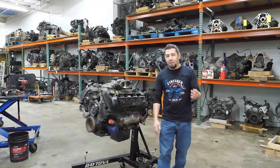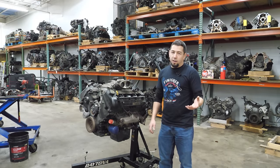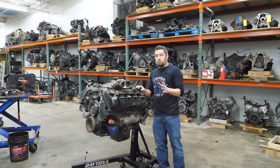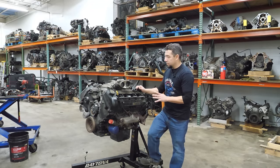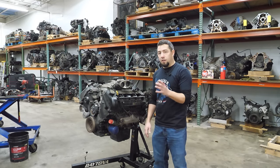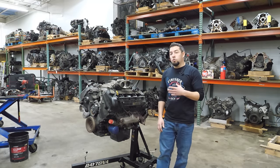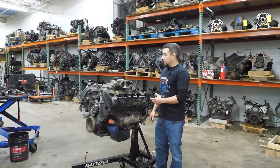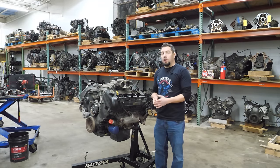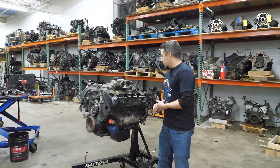I'm going to mention his YouTube gaming channel - he didn't ask me to, but I'll leave a link in the video description. This engine has 155,000 miles on it. It suffered some thermostat issues a few times, so it may have overheated more than once. It also started to use oil after overheating, and Ian admitted he didn't always check the dipstick as often as he should have. That's likely why the engine is on the stand.